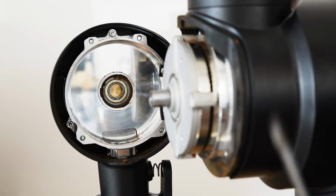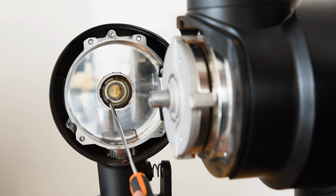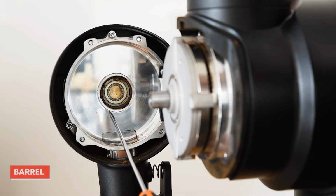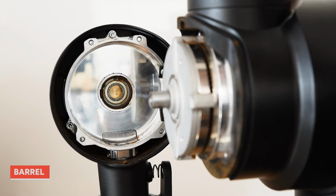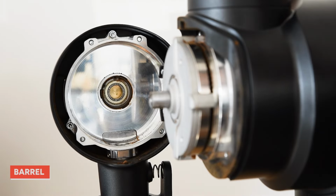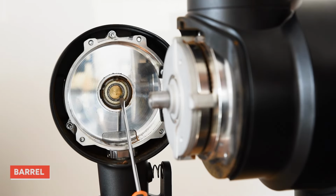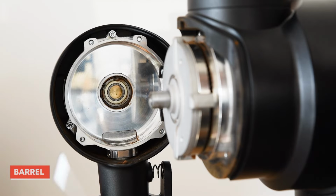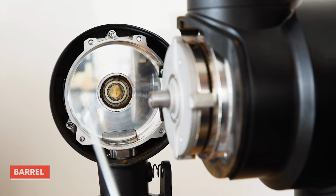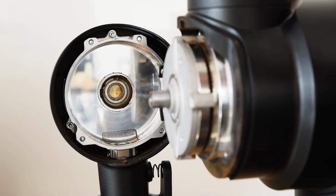We take advantage that the coffee grinder is open to show you a feature that I was mentioning before, which is the bearing. This part here is the actual bearing. This is a new feature that was not present before. So why did they put a bearing there? Well, because it keeps the axis, which is this thing, steady, and it stabilizes it. So this creates a very good advantage in terms of alignment. You're gonna have an axis which is more aligned than before, thanks to this bearing. A small detail that shows that Mahlkonig for sure thought about everything while designing this coffee grinder.